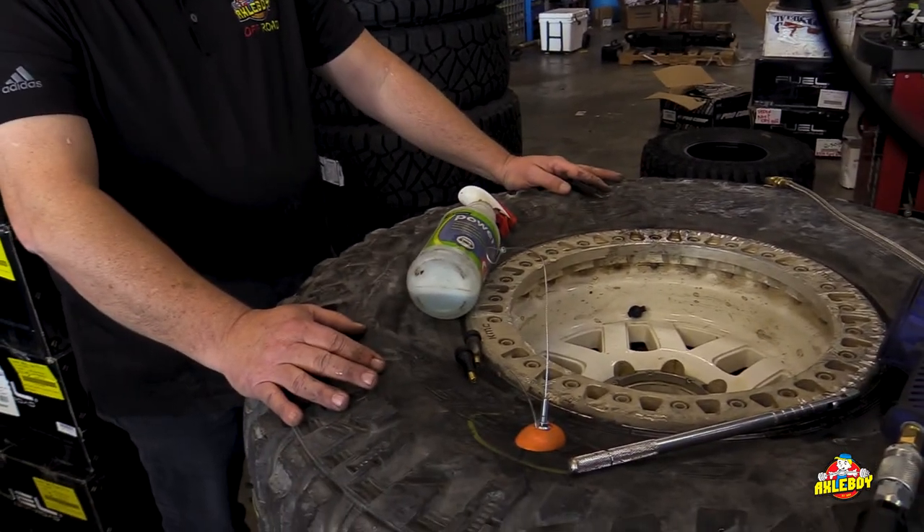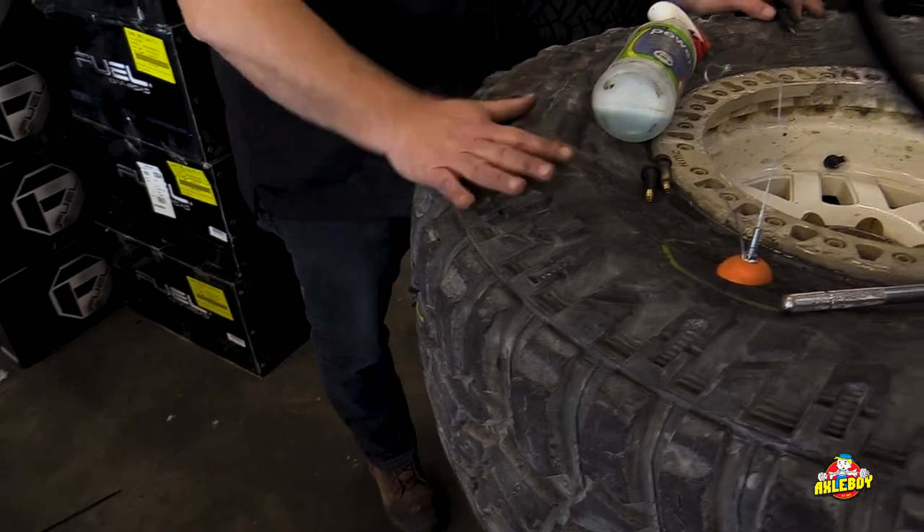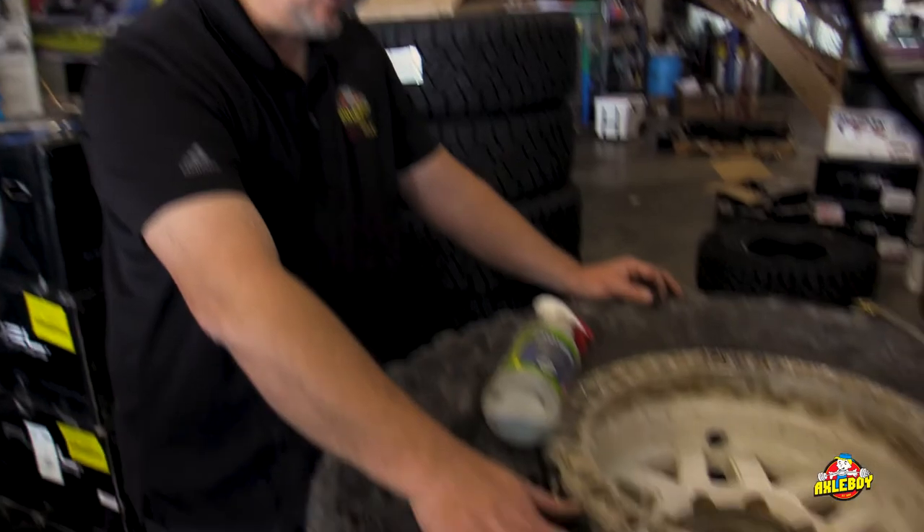When I get back to the shop, I'll have the guys put this up on a rack and change the tire out properly — totally safe and easy. You don't need a tire machine for any of these repairs. Remember: the sidewall slug and tire plug are not repairs for the highway — those are temporary repairs to get you back to the trailer, back to camp, just to safety. The Colby valve you can leave in and keep driving. Guys, I appreciate you watching the first in our series of trail repairs. In your arsenal you should have sidewall slugs, a tire repair kit, and the Colby emergency valve stem. We'll see you next time on the trail — thanks for watching.